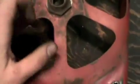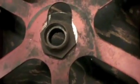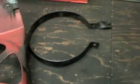I think it was repainted. Someone painted the gas tank black at one point and it oversprayed on everything, but that's all cleaned up. And the little thing that holds the bearings for the fan is all cleaned up. I don't know what you really want to call it, but that's all set. Washed the gas tank brackets, and I also brazed the manifold because I had cracked it when I had heated it up a while back.